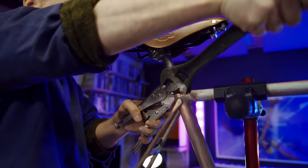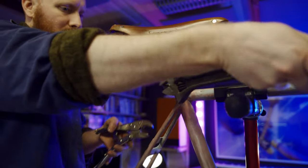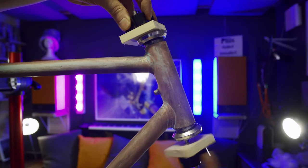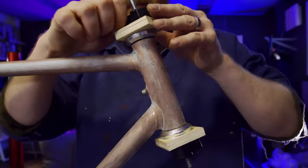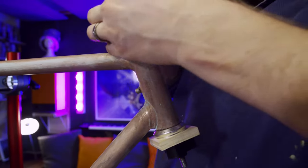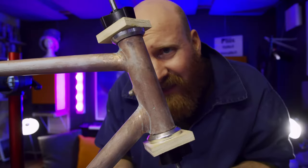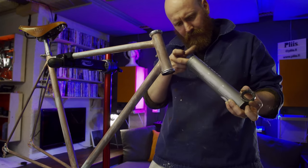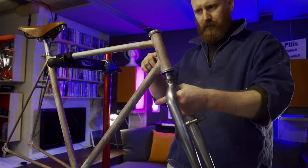The Brooks saddle is from all my bikes — I swap it from one to the other, because once you've made it fit your arse, there's simply no comparison. I did my best to DIY the tools as well. You can buy expensive headset tools, but a split pipe will knock the old cups out, and a threaded rod with some wing nuts does a wonderful job for next to nothing.